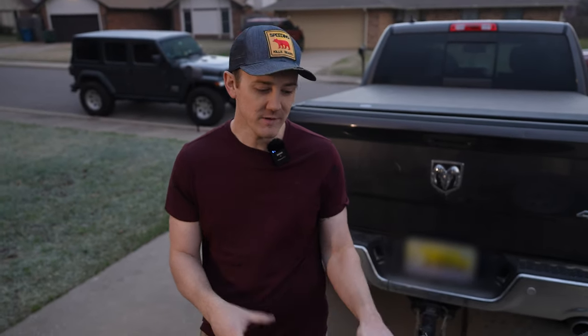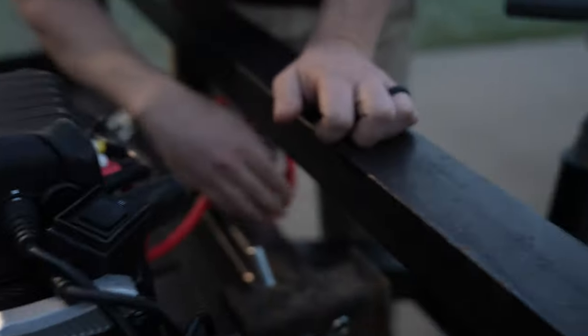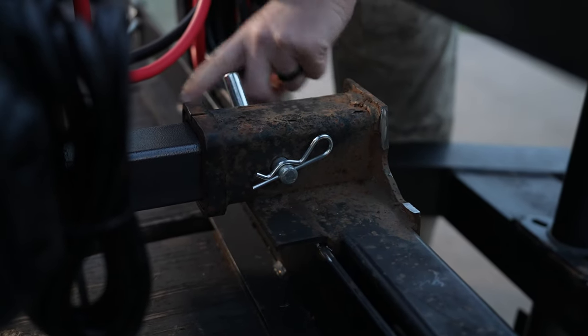Now I've seen a variety of different ways to get your winch mounted to your trailer. I wanted something that was removable because I'm not always going to want to use it just on the trailer. I might want to pull this out, put it in the Jeep. I wanted to be able to move this winch around as needed, maybe install it somewhere else with the receiver hitch, make it a little more versatile. I actually had a receiver hitch laying around from a Jeep Cherokee, so I just cut down this old receiver hitch to width and then welded it to the pieces of metal on the trailer so that the receiver hitch is attached to the trailer.